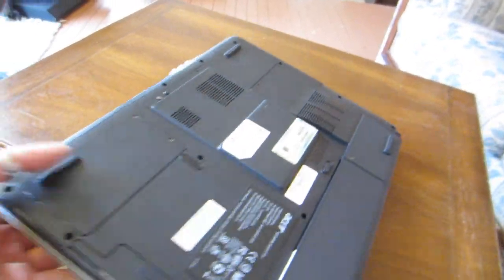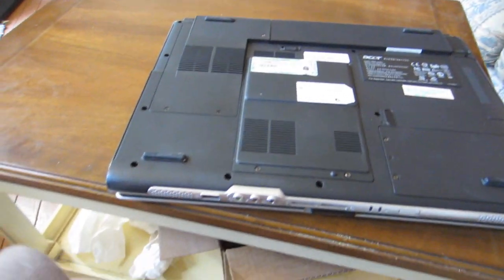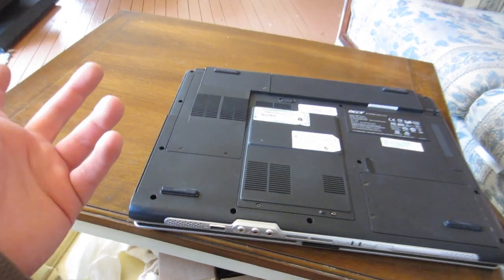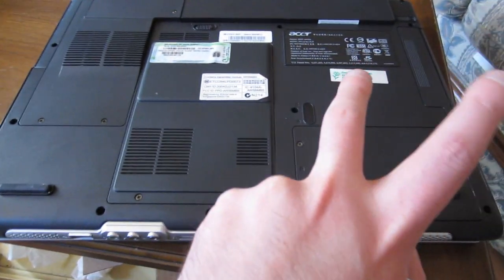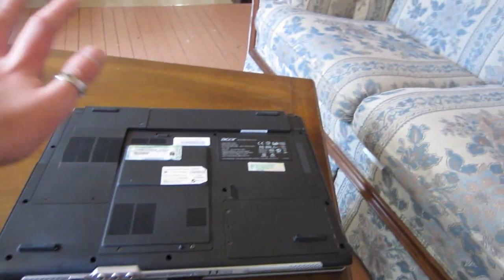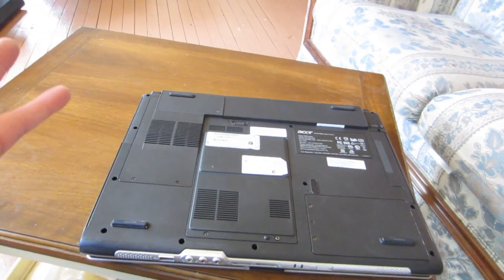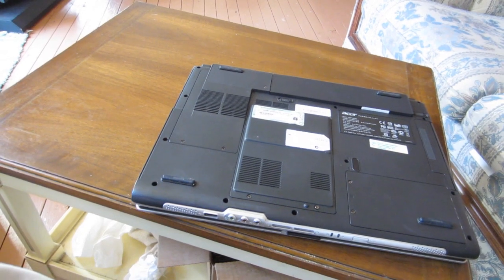So what I'm basically going to do is rip this thing apart. On most laptops you're just going to have maybe four or five screws on each of these plastic panels to get to the basic stuff like the hard drive, the memory, whatever. But first things first — you unplug the thing from the wall and you take out the battery, because you don't want to start frying stuff.